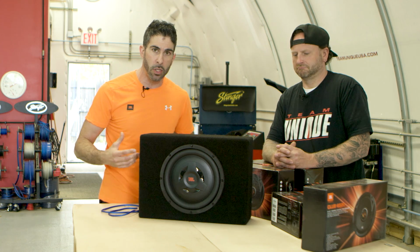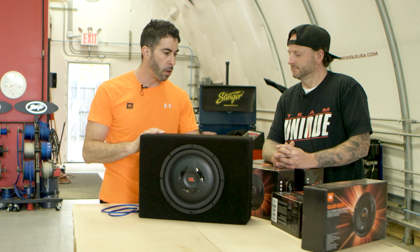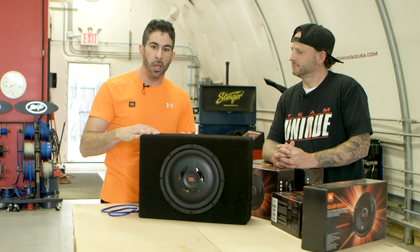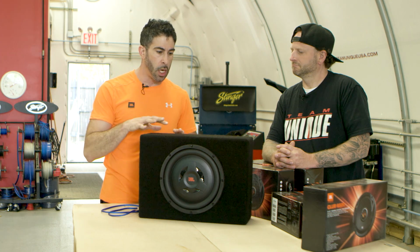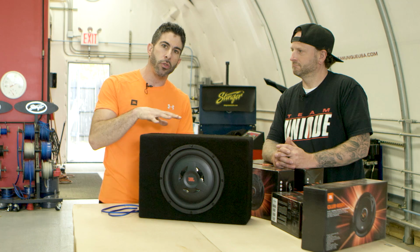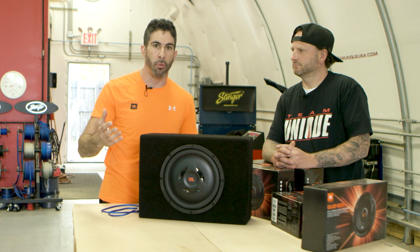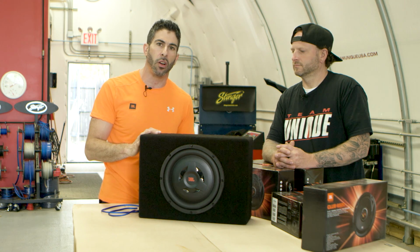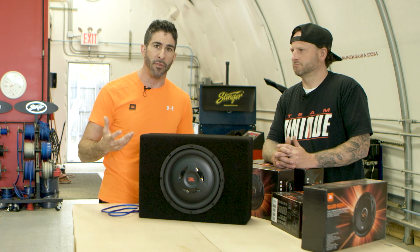We took all of our measurements. We used our box making parameters to build the right size enclosure. Reme used that really good wood glue. We seated everything, squared it up, used the nail gun to hold it all in place. We did use some industrial strength glue here. Most of you DIY guys at home aren't going to have access to a compressor and stuff like that, so using something like a Super 77, anything you can get off the shelf from your local wood supply warehouse, anything like that will be fine.